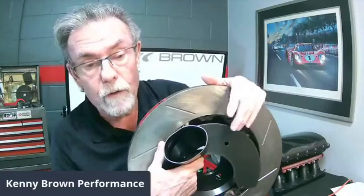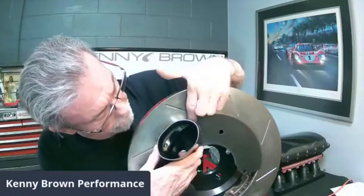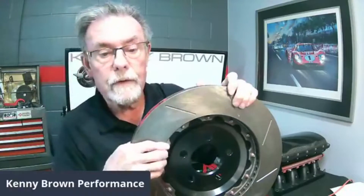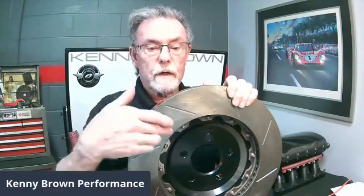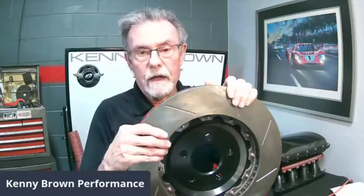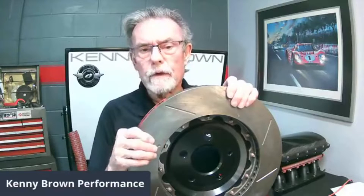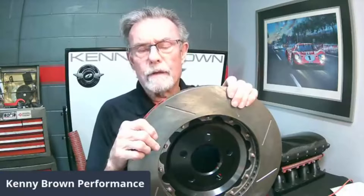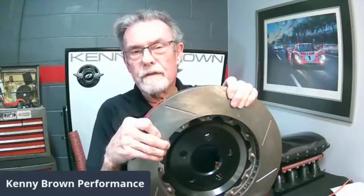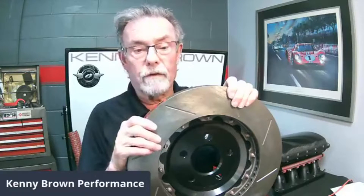There are a lot of four-inch ducts out there and you might think bigger is better, but a four-inch duct will come out and actually go across the face of the rotor. The air will hit the face, disrupt airflow, and cause turbulence. Secondly, you get uneven brake pad wear because you're running different temperatures inside and outside. We proved this during Mustang Challenge testing in 2010 — FR500s with four-inch ducts had different inside and outside rotor temperatures, which explained why we used brake pads at a different rate.